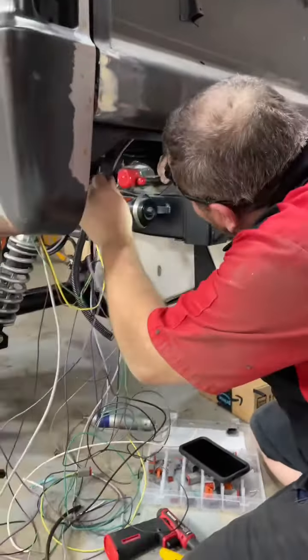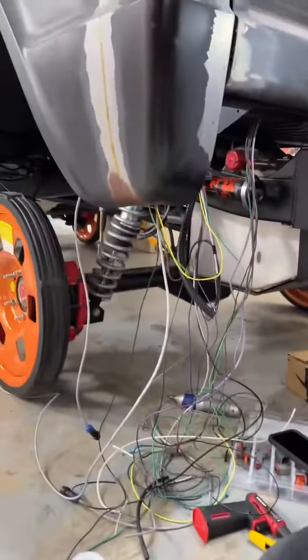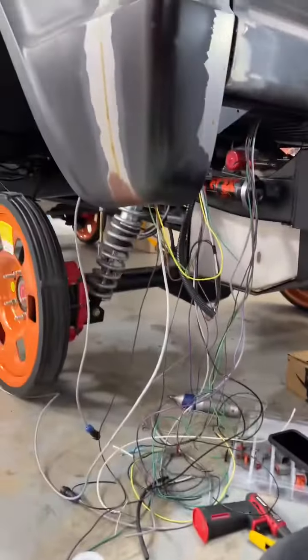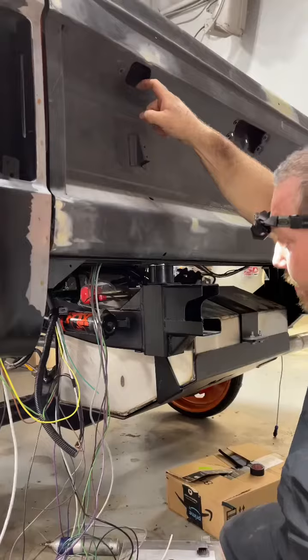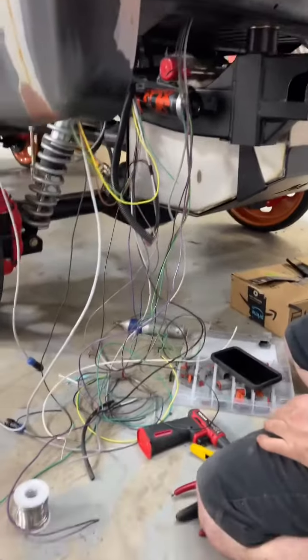What are you wiring up? Wiring up all the tail lights and the RGB lights for the wheel wells and underneath the bumper area, and pre-wiring for rear fogs in case we end up doing them. And camera wires for the camera we're gonna stash in the handle and the tag light up here, and extra wires in the top because I want to try and do an electric trunk release because I have a button on the key fob for it. So if it doesn't do anything, it's gonna really bother me. And I think that's it. Nice.